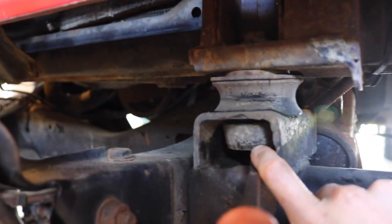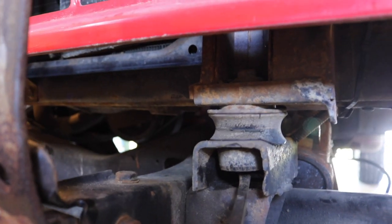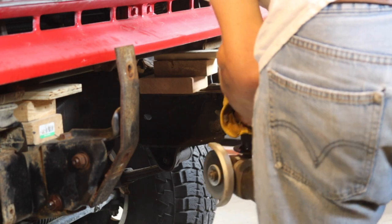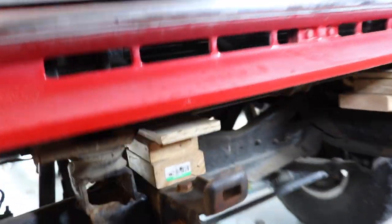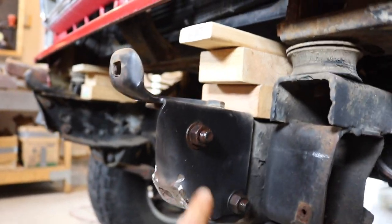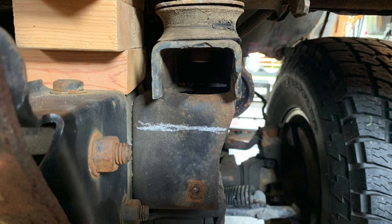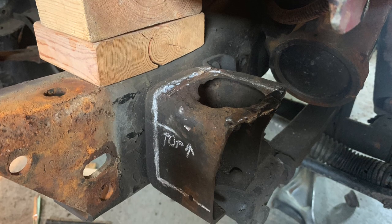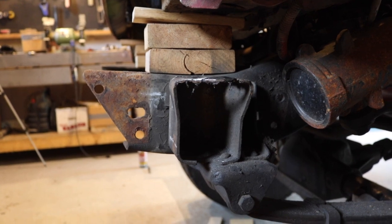Got the nut off from the bottom and I'm getting ready to pull the bolt out through all the mud and junk. The old bumper risers are cut off and ground smooth, ready for the new. Here's the original and then here's the one I just ground smooth — ready for the back-to-original bumper location. Taking this bracket off to gain access to cut it up and make it work at the new lowered location. That soapstone mark is the top of the mount where it's going to be.